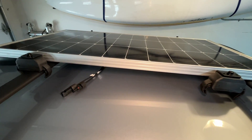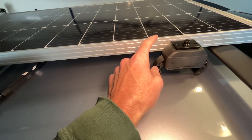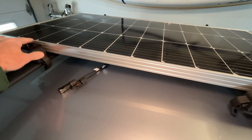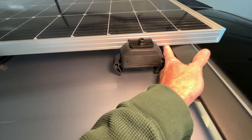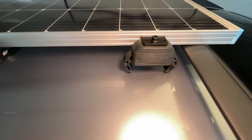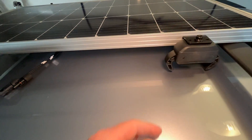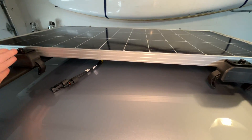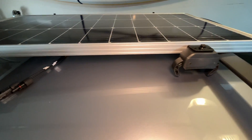Here I have the solar panel on this 2017 Subaru Outback, which has integrated roof rack rails. The crab mounts are set up with the existing holes in the panel. To mount it on this car you'd measure from the front of one rail to the other, then on the solar panel measure from one hole and mark it to drill. You could even it out and drill two holes, but it works just as well to use one default mounting location and only drill a hole on one end — then do that on both sides. If I want to switch between vehicles, it makes sense to set up the spacing for the Outback and then adjust the Land Cruiser's adjustable bars to match.